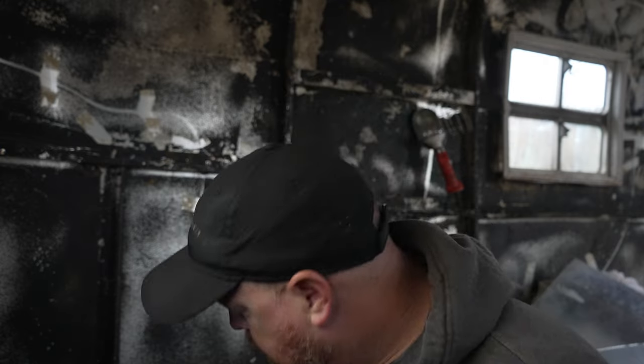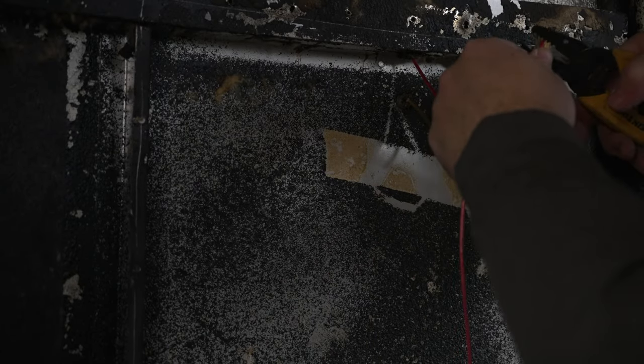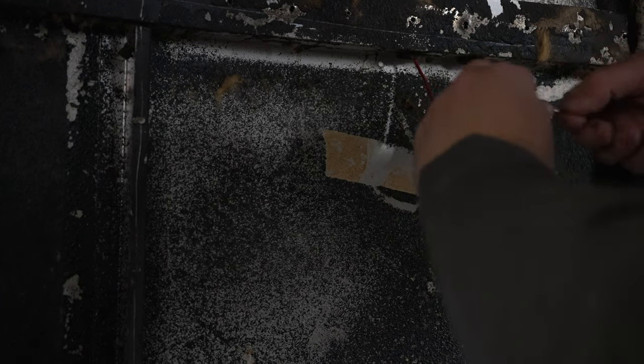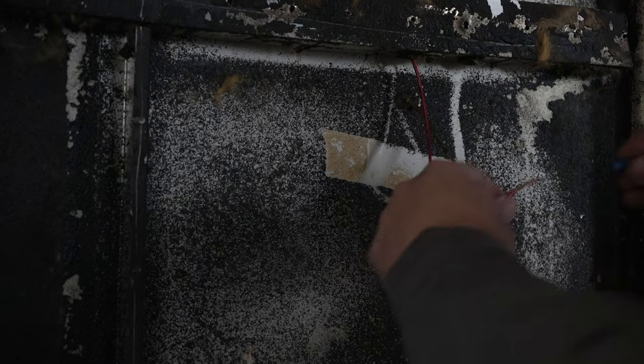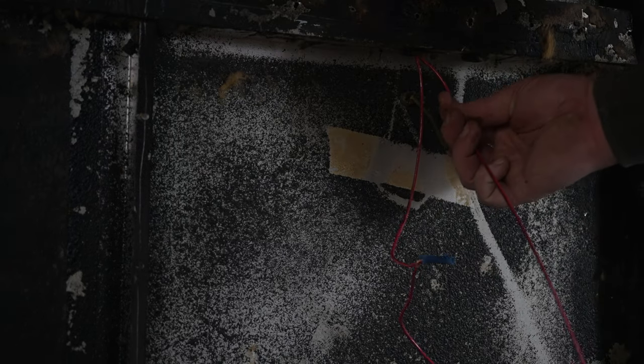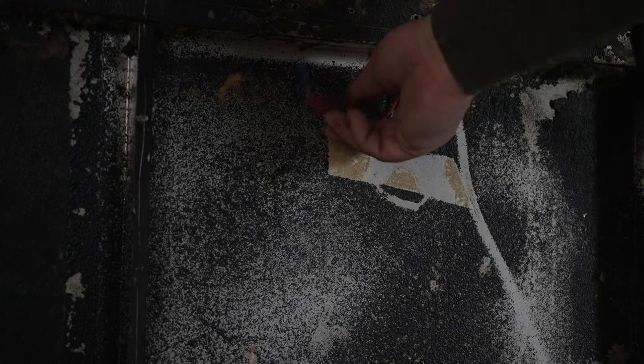So far I've got the two side lights near the front of the camper and I've got the two tail lights, which leaves me with the two rear side lights. Should have enough wire to finish it all - if not, I've got to go back tomorrow to get some more for the brakes. Tedious, that's all I've got to say. It's not been that hard yet, but I'm also nowhere near done. I think I'm done wiring what I can wire, which is just the side lights and the rear lights with the blinkers. Tomorrow I will go to the store and get some more wire to hook up the brakes and the other pins for the 7-pin instead of the 4-pin.